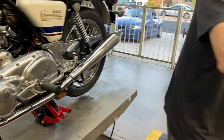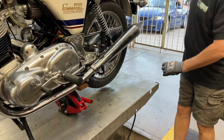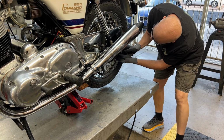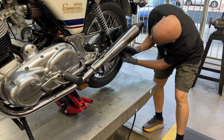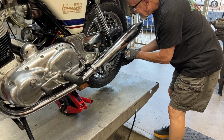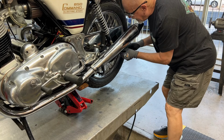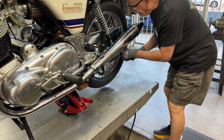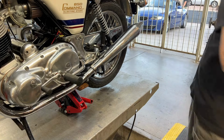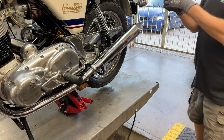We got the safety wire off now, bike in the air, and now we're gonna pop off the master link. I like this. I was gonna do this job, and Super K just jumped right in there. Can you get that one under it? Or you want this thinner one? Yeah, I probably need a thinner one. You can get it there eventually, but yeah. Why wrestle? This is why. Typically is. Oh, that's thinner. Nice. Yeah, that's nice.